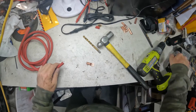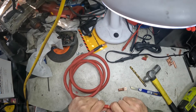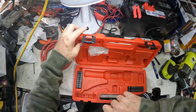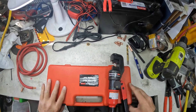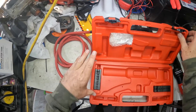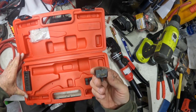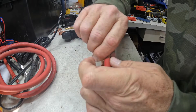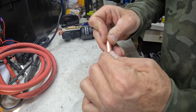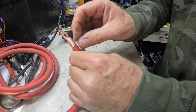Okay, let's get this on. We're gonna measure this back about that far right there. Of course, there's lots of ways to crimp lugs on cables. This is the Harbor Freight hydraulic crimper. These are the two gauge dies — that's not the biggest one it comes with. It comes with several dies; the biggest ones are zero and the smallest one is 14, so it gives you a good range. We don't really want to twist the wires because twisting them tends to make them bunch up bigger. Just try to get as many in here as we can. We got them all in there but these little stragglers.